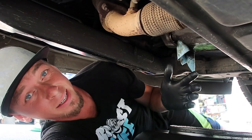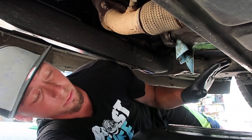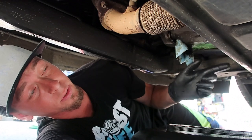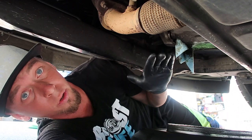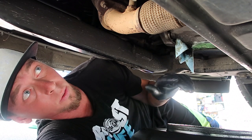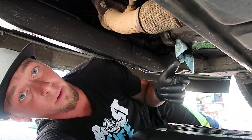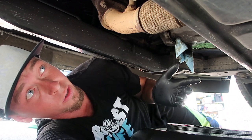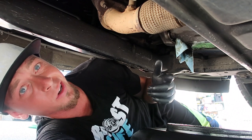Because I like to get as much oil out of the car as I can, I put the actual drain plug back in but only finger tighten it. Once I put the oil filter in, that allows time for some of that oil to work its way back down to the pan. Then I'll actually go ahead and undo the oil drain plug again to get as much of that old stuff out as I can. It helps in the long run — the more good you put in, the longer it's going to last.